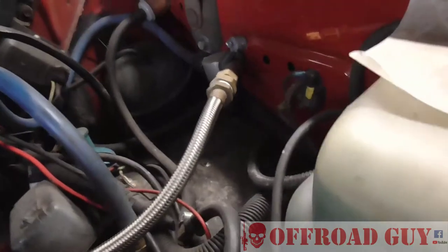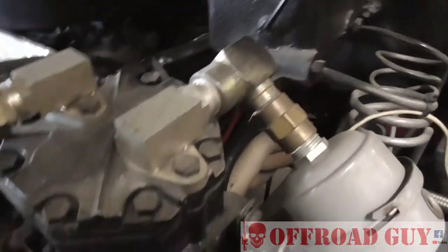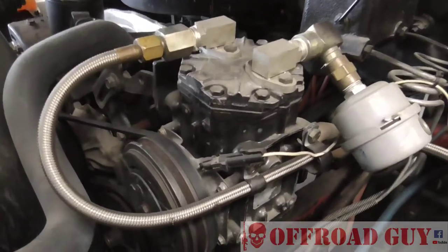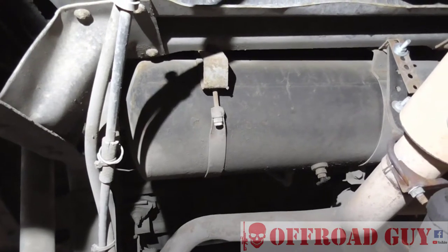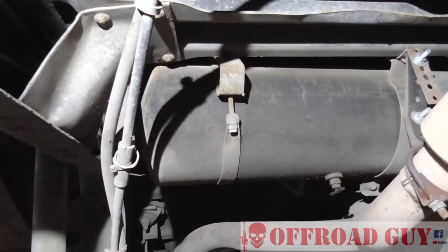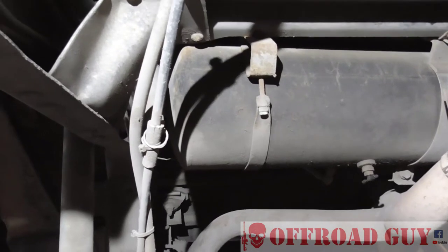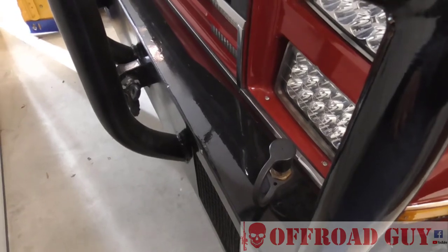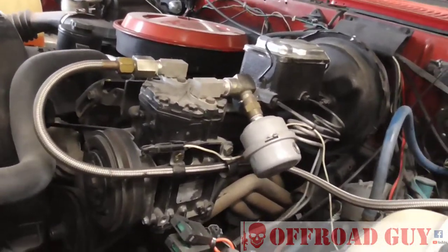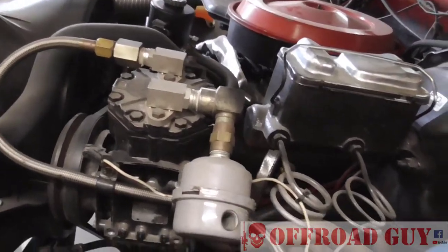Because of the oiling system it does put out a bit of oil, since you basically fill it with engine oil. So I added a water separator that I'm using more as an oil separator to cut down on the oil in the system. I've welded up some brackets, took out the AC, and put this in its place. The air tank I got from a big rig junkyard for about $35. It's mounted basically underneath the Blazer where the rear passenger seat is, and then I ran air fittings to the front and rear bumpers on opposite sides.